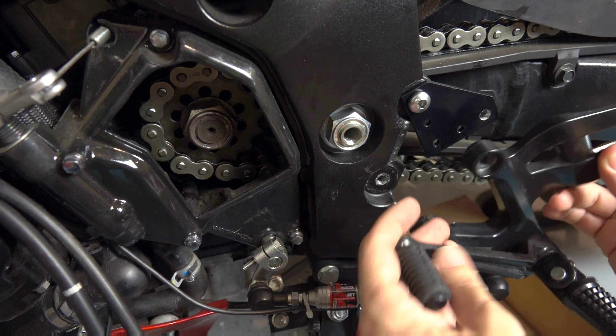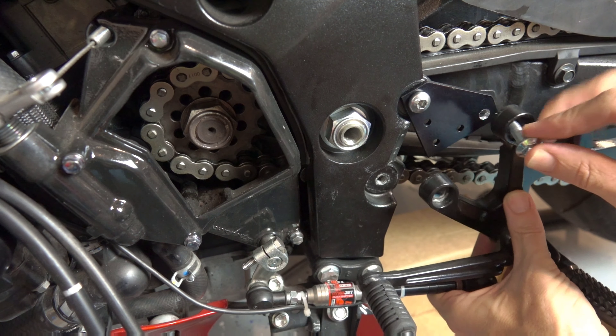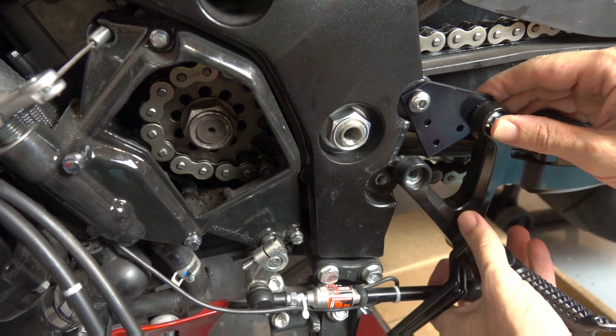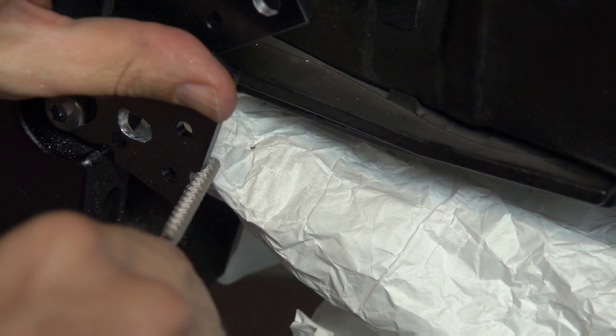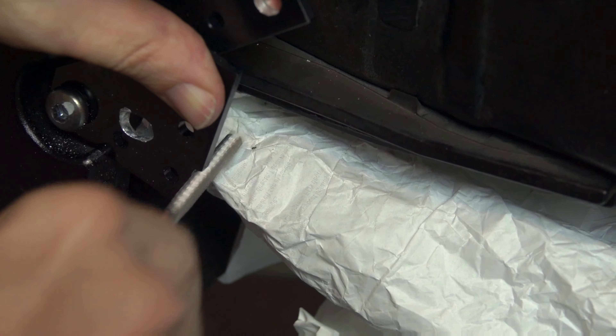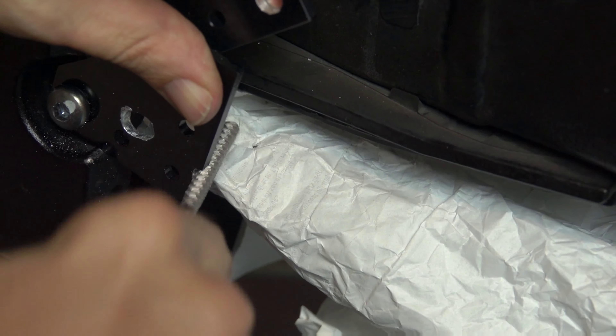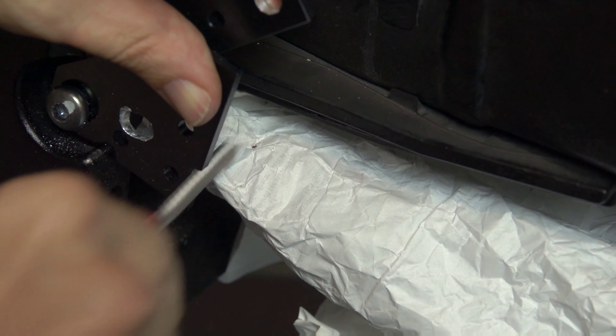When I was hitting the shift, I was actually hitting the side stand — and that's not good. So I'm back to the drawing board, trying to understand how much I have to run it out from this area just so I can let the rear set move forward a little more and create some space between the shifter operation and the side stand.